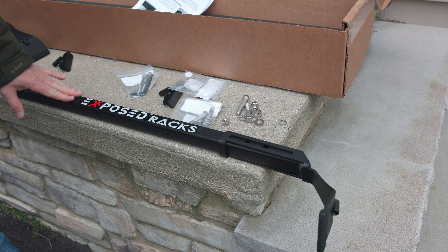This side facing the front of the Jeep has the logo — it looks good, gives a little pop of detail. To keep this a clean installation, I'm going to put the carriage bolts in with a regular flat washer and a lock washer. Lock washers keep the nut from loosening. We have two extra washers — we could put those on the head side of the carriage bolt, but it doesn't mention them in the instructions and I wouldn't be a fan of that look, so I'll use those as spares. We'll put the nuts on but leave them loose so we can slide them.